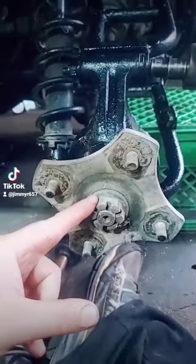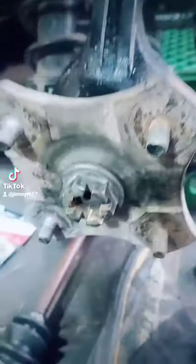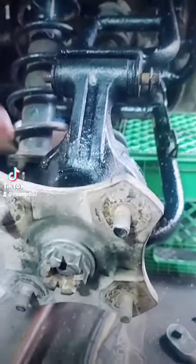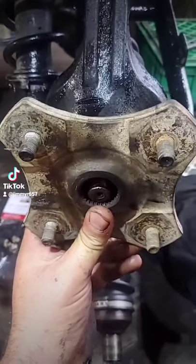On the CAT 700, we're gonna take the nut off and then the top nut off and it'll slide down. For anyone not knowing what size the nut is, it's a 30 mil. We'll get the nut off, get this pin pulled out, and take off this here, and then it'll drop down. We'll get this hub off and the knuckle off, and we'll get the axle out.